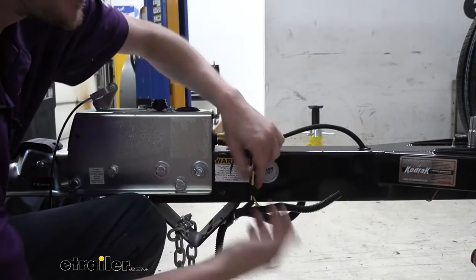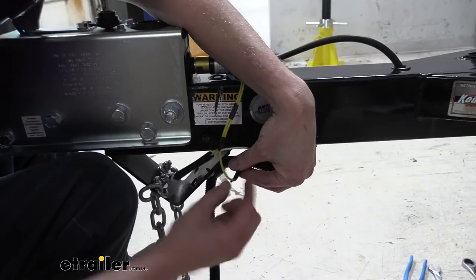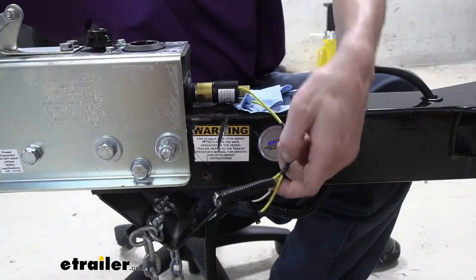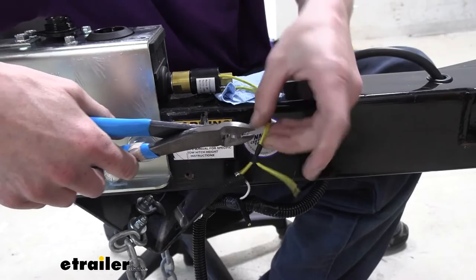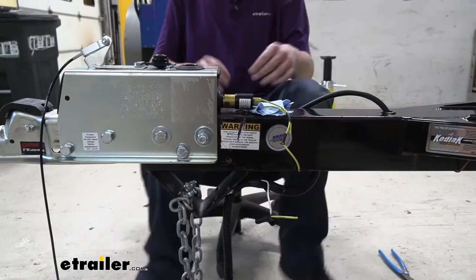The other wire in here we're going to disconnect — we're looking at where they've been connected and we'll cut our wire at an appropriate spot. It looks like this is likely where it was wired in last time, so we'll make sure we've got enough wire length. We'll snip it off here and clean that up. This appears to also be a redundant ground tied into that ground wire, so we'll be reconnecting to that, leaving ourselves a little extra length.